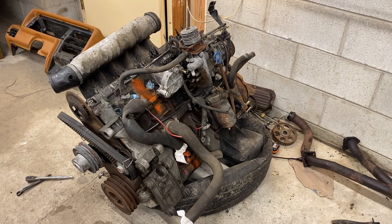So what's next for this project? We've got the kerosene sitting in there marinating, and that's going to need to sit for a good long while before we can try to actually roll it over again. In the meantime, for the next video we'll be pulling the injection pump and going over a lot of the accessories that this Volvo Bosch injection pump has — some ideas for deletes, upgrades, things like that. Then maybe stripping the head and getting ready to pull it while we let the engine stew in its kerosene. Hopefully it'll free itself up; if not, we'll just have to take it apart more. Until then, thank you very much and have a good one. Stay tuned.